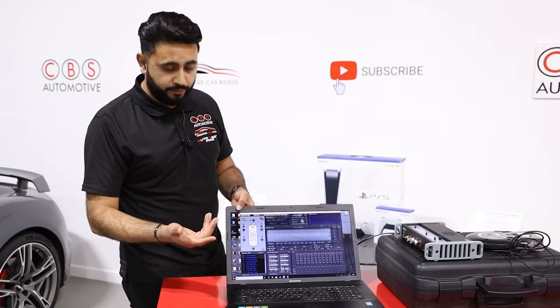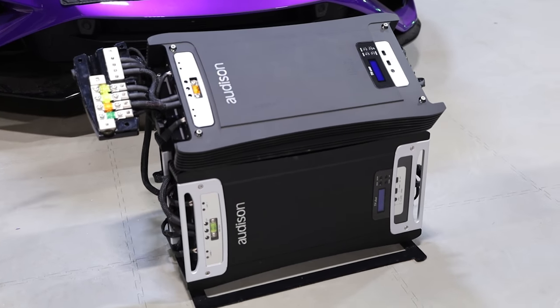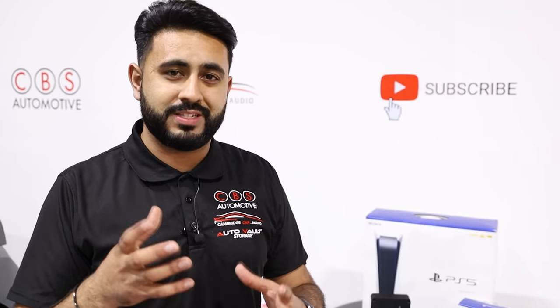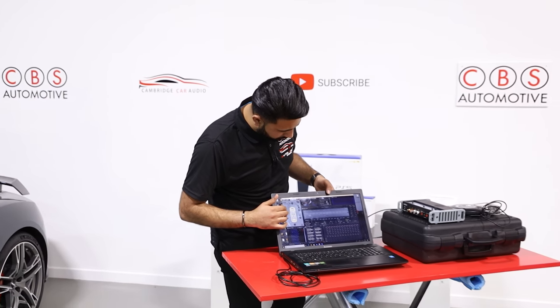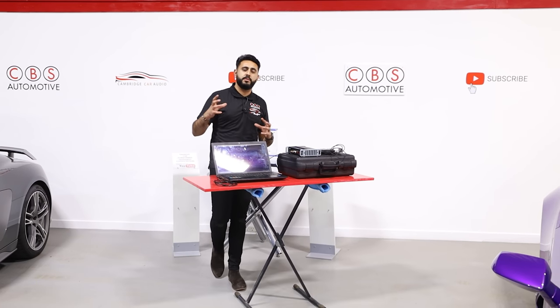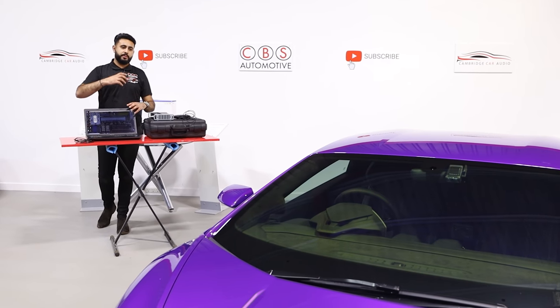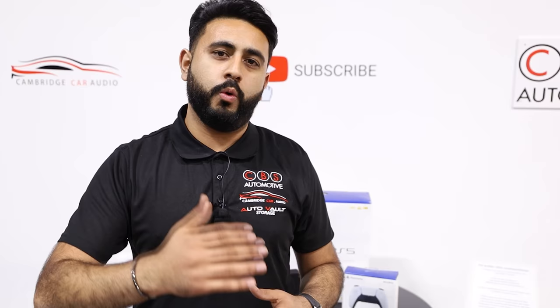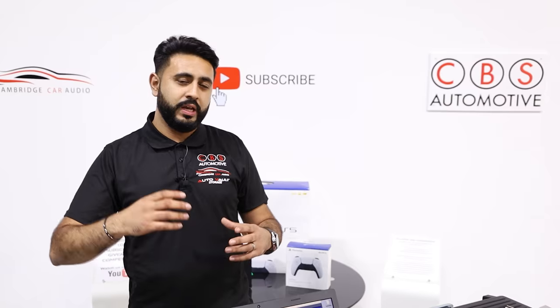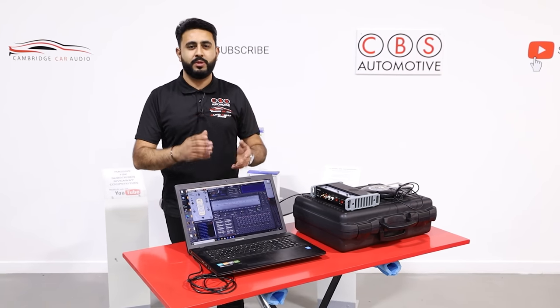We're running a two-way fully active front end, meaning each amplifier channel runs directly to individual components: the Audison Thesis Duo running tweeters fully active, another Thesis Duo running the Thesis Sax fully active, and the Uno running the two subs. We're using master input, taking high-level signals into the processor, where we de-equalize the factory radio and clean up the dirty signal. If you amplify a dirty signal, you amplify dirty noise - the Virtuoso corrects all the factory processing before it reaches the amplification rack.